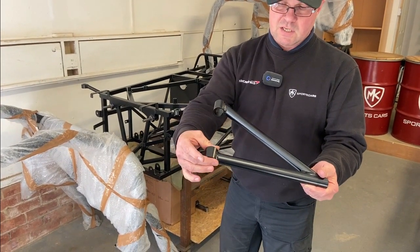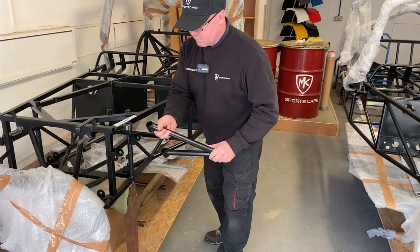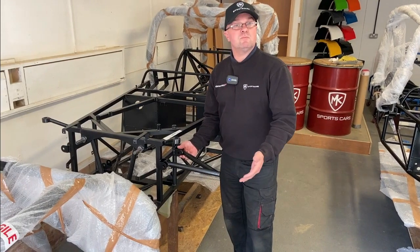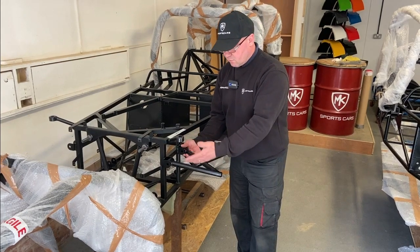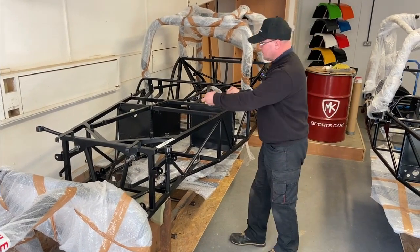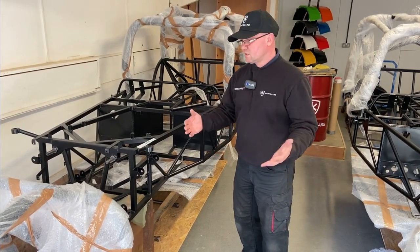It has a crush tube and a rounded bush in there, and that sits on the wishbone. As a poly bush car, there is minimum adjustment in terms of setting up for caster and toe alignment on the rear of the vehicle. We have a similar wishbone that sits on the back of the vehicle, so it's kind of set in the factory — perfect for a road car and occasional track day use where you don't really want to mess around with the vehicle and its settings.